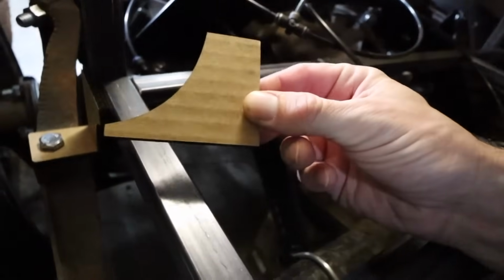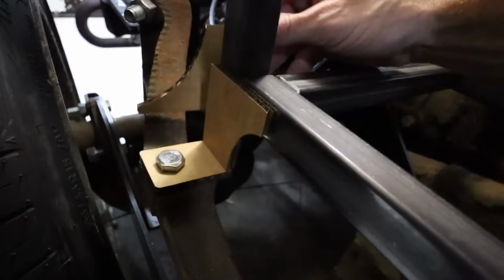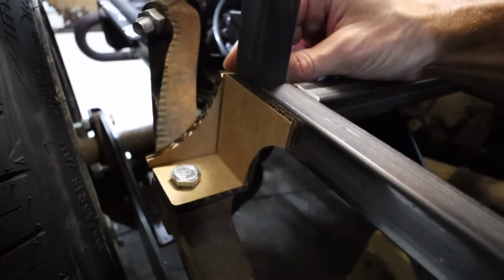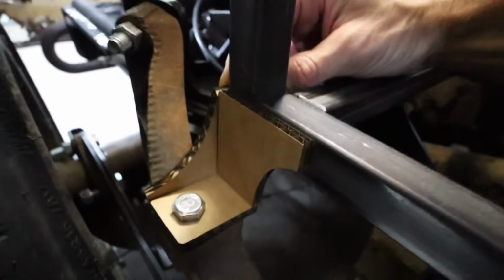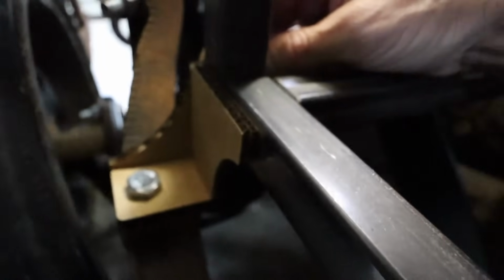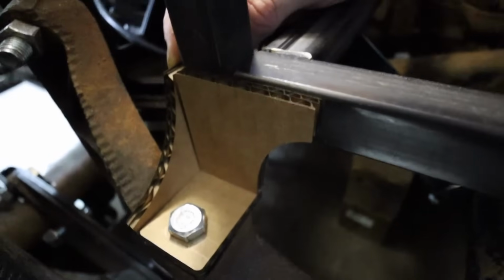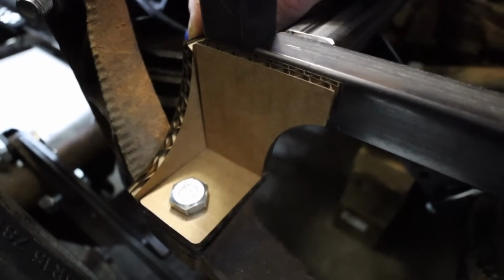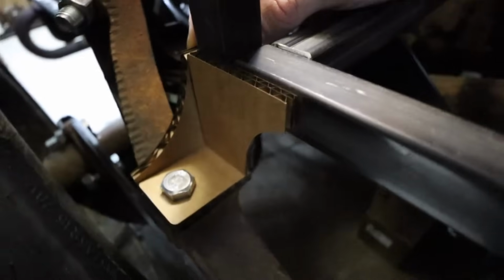So we made the third piece, which might be the final piece, and that one's gonna go right back here like so, just like that. Basically a gusset out of each plate on both sides. So let's go cut these out of steel, we'll tack weld it together, and we'll see what else we might need to change on them.